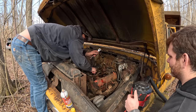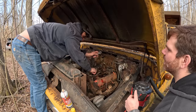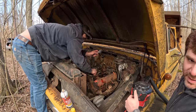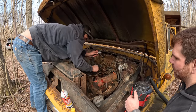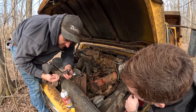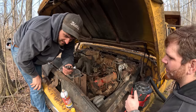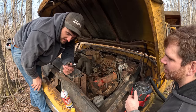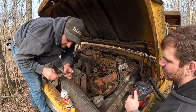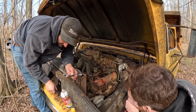Spark plugs honestly still look clean. He tuned this up. He told me one of the last things he did, he rebuilt the carb and did a tune up on it. Brand new. He's running a little rich. He did say, I think he did say, he was running rich. Nothing to get bent up about. No. Old Champions. Is that him walking down?